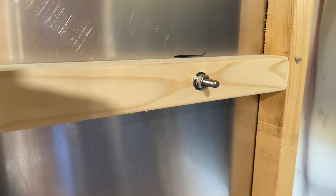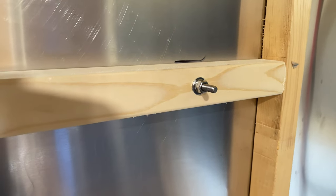So I just wanted to explain a few things before we get going in the video. In the back wall here, what I'm gonna do is actually cover this with a very thin plywood. And the reason for that is this. First of all, there's some nuts that are exposed when I installed the solar panels on the back. So I have two options with that. I could just run some small thin strips of wood and then put the shiplapping over top of that. But I decided to put a thin layer of plywood, and then I'm going to adhere the shiplapping to the plywood, probably using adhesive caulking.